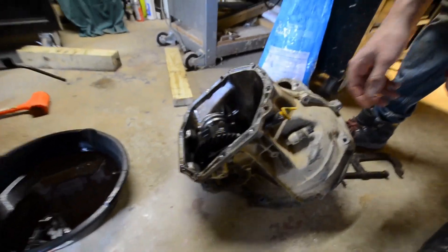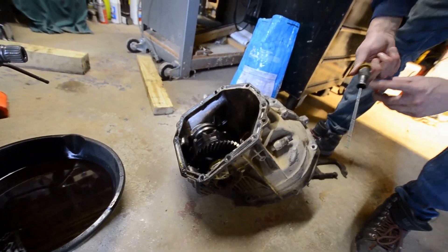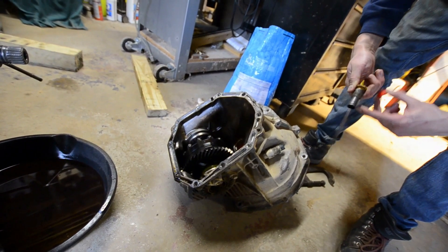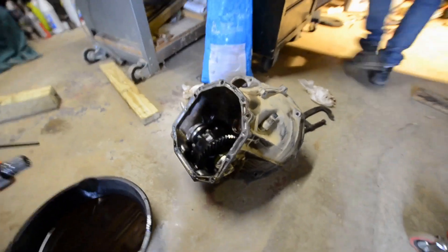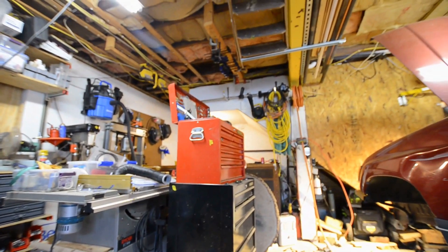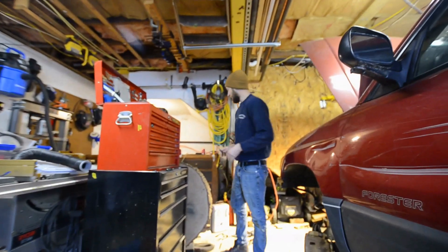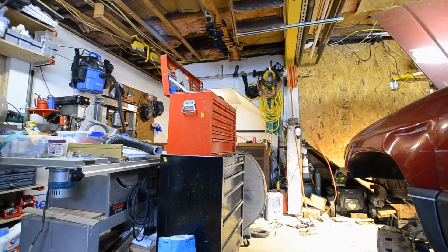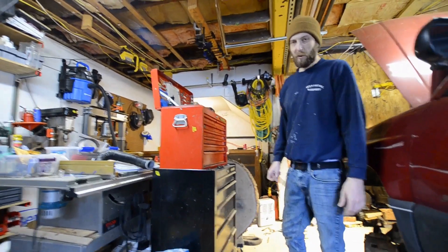Instead of just the dipstick going in here like this - that looks nasty. I had to put the vice grips on it and pull the whole thing, because normally it seats down and up to there, but the little thing had broken off. So I pulled the whole thing out, separated it, held on to the vice grips, used a hammer to tap the dipstick tube back in, lubed up the O-ring on the dipstick, and put it back in to actually check the level - only to find it was bone dry.